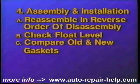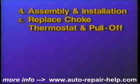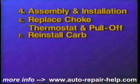Reinstall the idle mixture screws and reset them to the same number of turns as noted during disassembly. For best results during rebuilding, we also suggest replacing the choke thermostat and choke pull-off. Reinstall the carburetor onto the intake manifold, being sure to use a new base gasket.